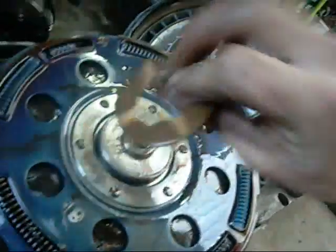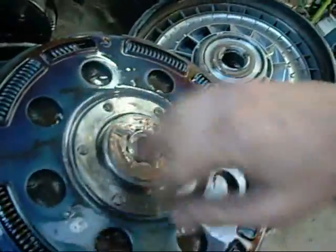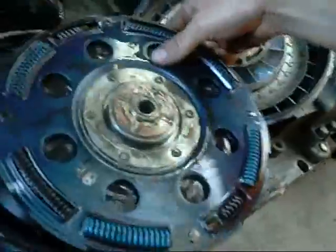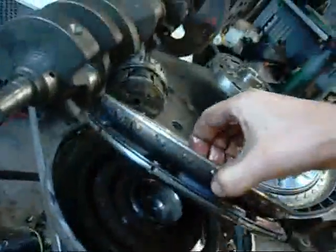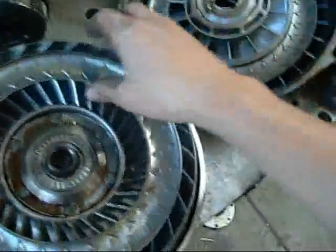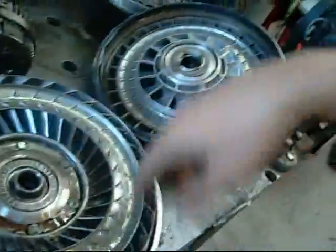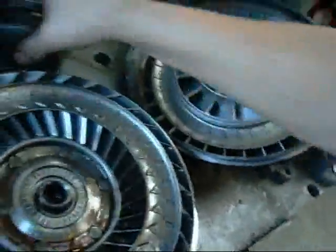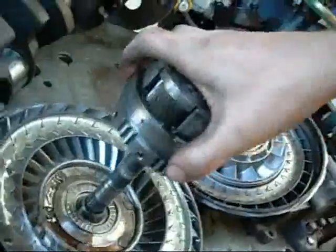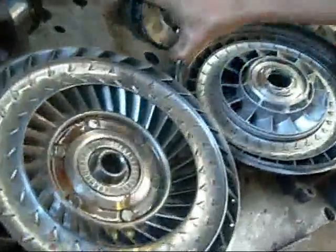There are springs and take-up bits on it, a brass bush and thrust bearing. Not a lot to them - it's just dependent on fluid to create enough resistance and spin this inner piece. They do multiply torque at low speed unlike a regular manual transmission. That's about it for this one.